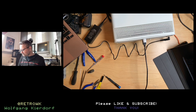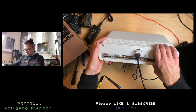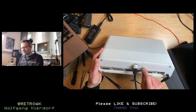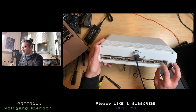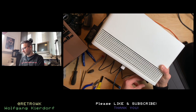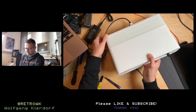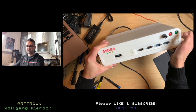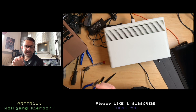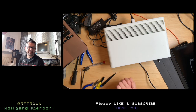So this is my HD mod — let me show you the back of the console. I put in the HDMI connector here, which is a standard HDMI connector, and this button to activate the RGB-to-HDMI menu. You can see a little bit of the cable tie here — that's okay. So this is now a two-plug solution: HDMI and power, and of course a mouse or joystick in the front. Let's quickly test — should show Dungeon Master. Flash Floppy, Dungeon Master — yeah, all the LEDs still work, nice.